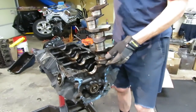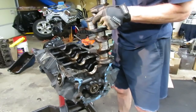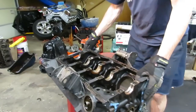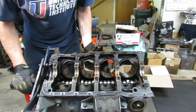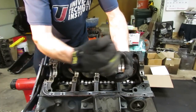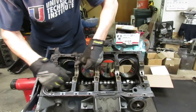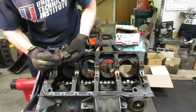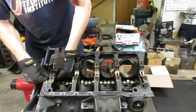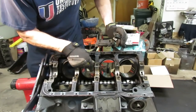That's really all there is to it. We're going to mic this out and see how it is, but there's some wear on this — I think we're definitely going to have to grind the crank. We'll deal with that later. Now we can take a look at the bottom end main bearings — they don't look too crazy, but again you can see that copper on one half of that bearing. That thrust force going back and forth — it looks like they all pretty much took the hit down here. That one actually has some rust embedded in it, so we've got a couple of different problems: liquid in our oil and a thrust bearing that's wiped out.